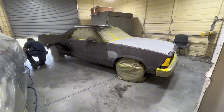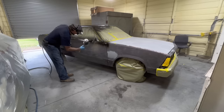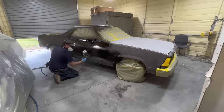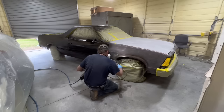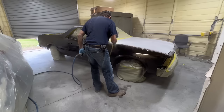I got a lot of runs last year because I'm losing my vision and my depth perception is almost gone. So I get too close with the gun a lot of times. It's not that hard with this sealer or base coat because they're not putting out a lot of fog, but when clear is going on and the fog is thick, I lose my bearings and spray over the same pass I just made or get too close and cause big runs. I'm not trying to spray the sealer all wet, but it's going on pretty slick, and I am going to tack it before I spray the color, so I'm glad it's so smooth. When I do tack it, I can feel that there's hardly any dirt in it.